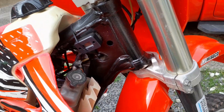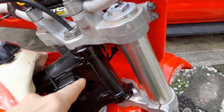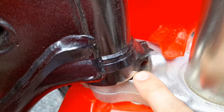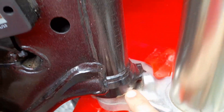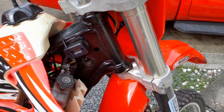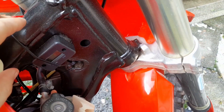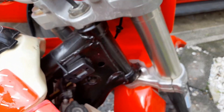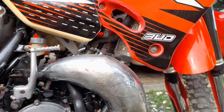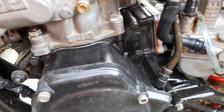The next tip is to paint your frame after you've disassembled and cleaned it really well. You don't have to fully disassemble the bike — you can leave the triple clamps on and just tape them off with paper. The philosophy of this video is that you can do a nice quick renovation without doing everything completely perfect; it would take five times longer to do it absolutely perfect. I spray painted the frame black and then applied a clear glitter coat from a long distance to give it a two-layer finish — probably only cost about five dollars. I also painted the engine cases.